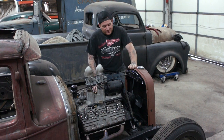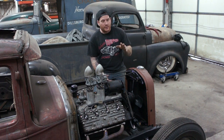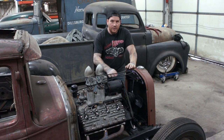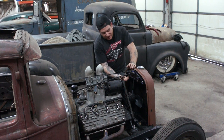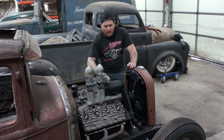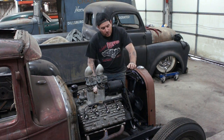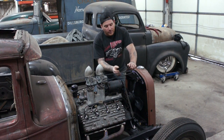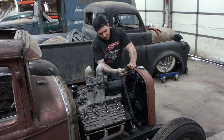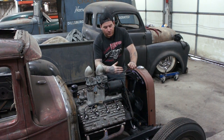Now we're on this side of the radiator. The first problem I had is that if you're channeling or chopping your grille on a 32 radiator and you're running a flathead V8, it has two coolant outlets coming out of the head. The stock 32 has them coming out underneath the tank here. What that does is your fan is going to run into your outlets and it's going to go down and then back up — a little awkward. So I wanted the outlets to come up top here so it would be a nice flow, kind of like it would have been originally. I couldn't use a 32 top tank because of where those outlets came out, and a 32 tank comes down at a sharper angle up top and doesn't leave enough room to put necks in at a point where they're level with the water outlets on the head.